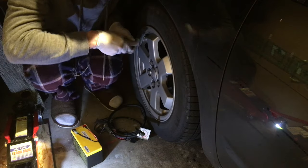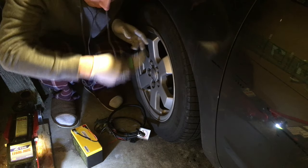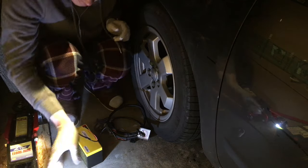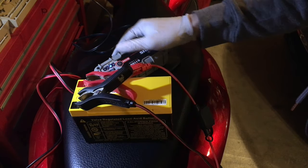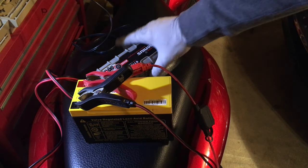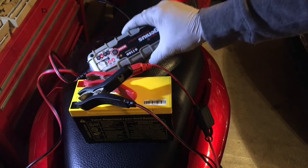I cut out about half the tires — this is only four of eight for two vehicles. That rounds out the end of the session here. I'm going to return the battery to its charger. Once you're done using lead-acid batteries, it's always a good idea to hook them back up to their charger — lead-acid batteries last longer if kept charged around 13.26 volts DC for a 12-volt battery. Cheers and thanks for watching, have a good day.